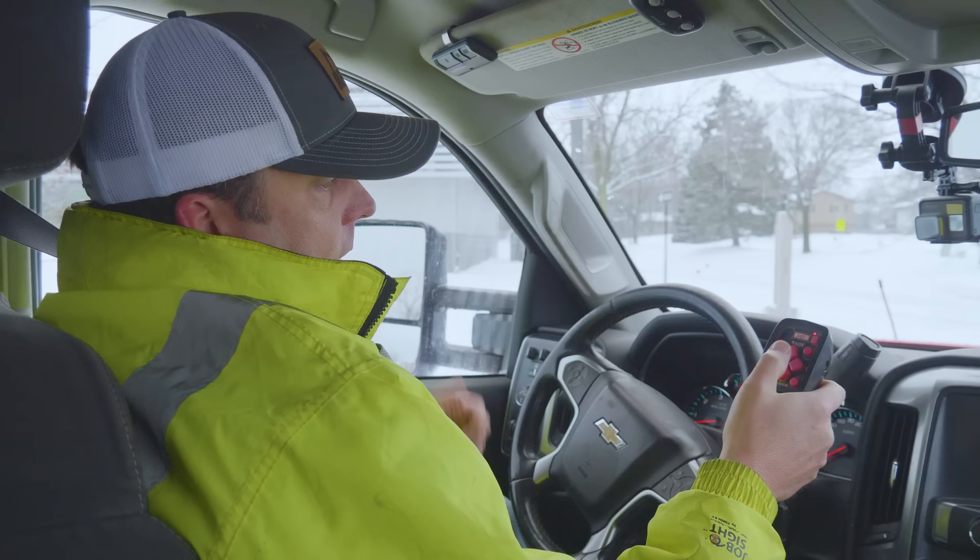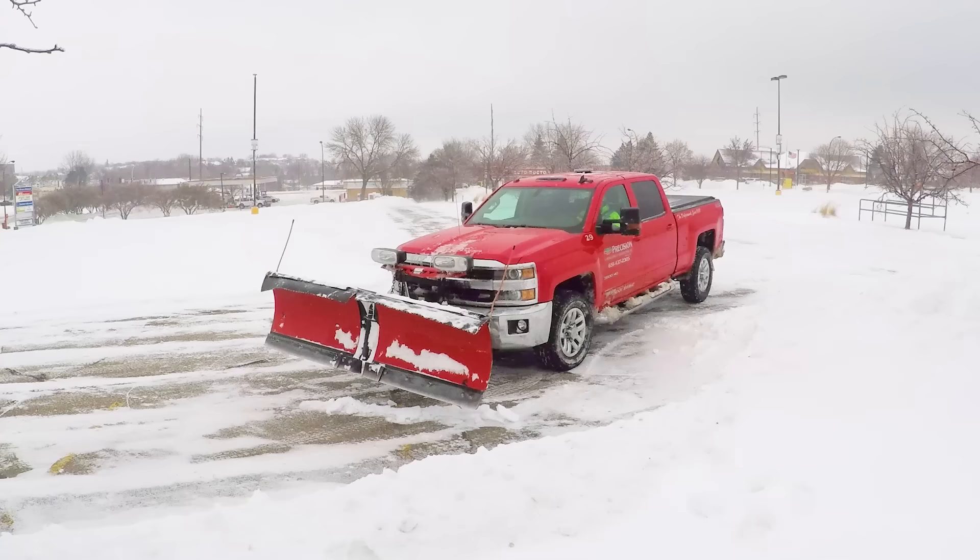I'm going to straighten it out here. Typically when you're traveling, you're going to have this blade up. And then you often want to have it at a little bit of an angle — that allows some airflow to come in. The radiator in the front of the truck still needs airflow, so if you're at a little bit of an angle, it'll still allow access in there. And plus if you do end up hitting anything, you've just got that one little corner down there — it's a little bit safer driving with it at an angle versus straight.